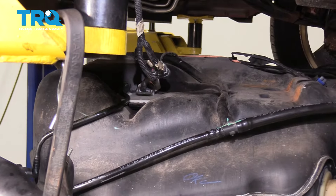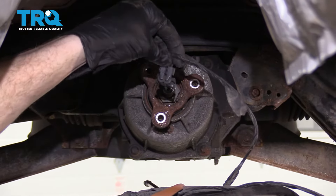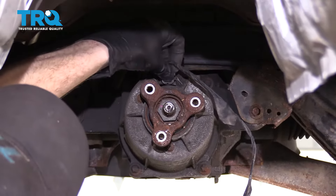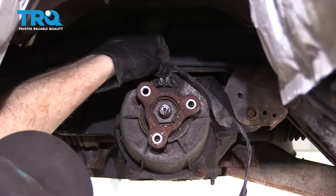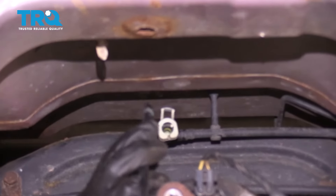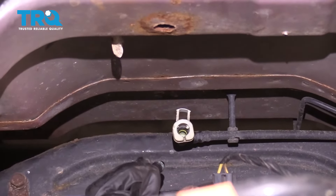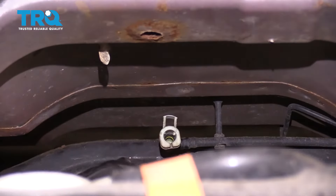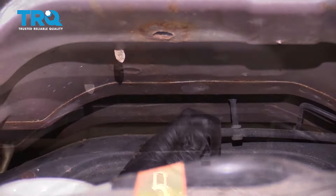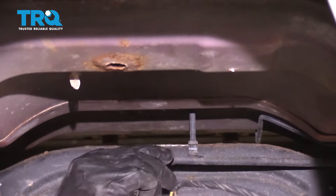Start bringing the tank up. Continue with the electrical connector that goes to the speed sensor on the rear differential — make sure it's facing up so the wiring goes straight up toward the body of the vehicle. Slide it into position, press it in, listen for a click, give it a nice tug — that feels secure. Now install the EVAP hose going up and over the differential. Jack up the fuel tank until it gets into position, squeeze the two connectors together, press it in, make sure you lock it down with the corresponding tab, give it a little tug, and make sure it's secure in its mounting point.